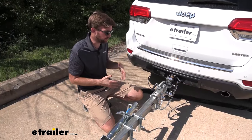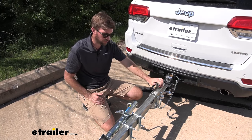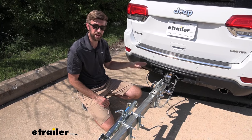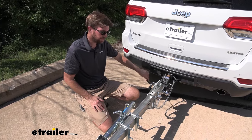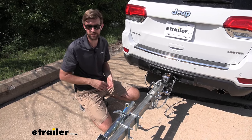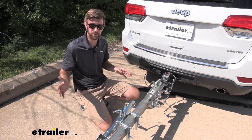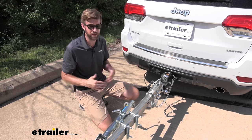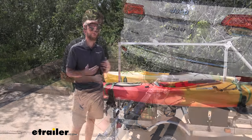When it comes to connecting to your vehicle, you definitely need a hitch and a ball mount with a two-inch ball. The trailer comes with the coupler, jack, and safety chains. You also need to make sure you have proper trailer wiring — this is going to be a four-flat or four-pole connector that gives us all our trailer lights. Most vehicles can haul this trailer; it has a capacity of a thousand pounds and the trailer only weighs about 325 pounds.